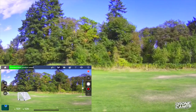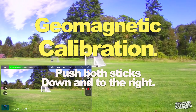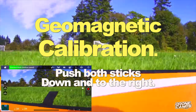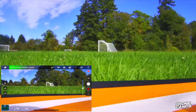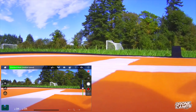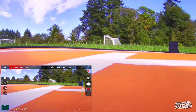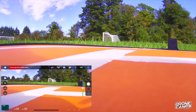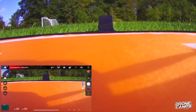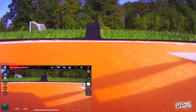If that happens to you, do a geomagnetic calibration: land your drone and take both sticks down and to the right. When you're landing, you can press the auto-land button, press and hold to shut the motors off. Take the sticks down and to the left and you should see the LED light in the very back start to flash. On the screen it'll show geomagnetic calibration. Once it starts flashing and goes back to green, you should be good to go. We have 12 satellites and I'm still recording video.